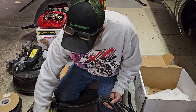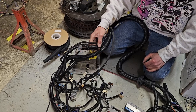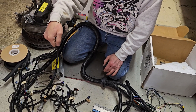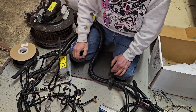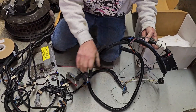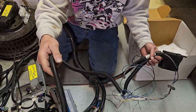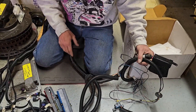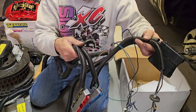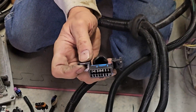This is what you get from BP Automotive - all this stuff just plugs into one place once you get it on top of the motor. You separate your bank one and bank two, and it literally lays almost in place: the coil pack wiring is right here, the injector wires right here - super easy. A lot of people run harnesses in the motor bay, which I absolutely despise. I like my stuff neat and clean; I don't want all the extra clutter in the motor bay. If I can hide it under the dash, that's a better place.